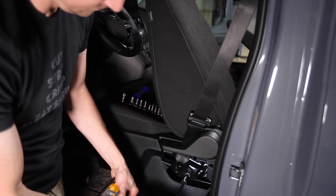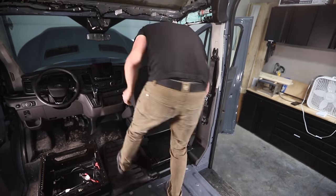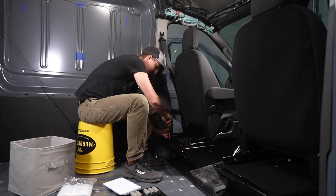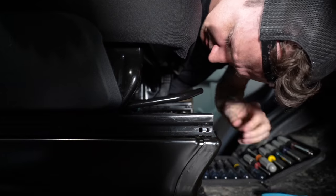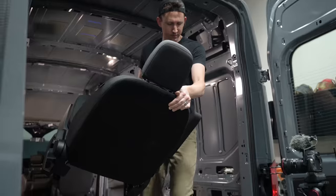The first step in this process is honestly just a ton of prep work. We needed to access the metal under the floor liner and seat pedestals, so we started removing the seats. We slid the seat forward, removed the rear battery tie-down screws, the battery cables, the seat-to-seat base bolts, the wiring harness under the seat, the seat belt restraining cover, the seat belt bolt, and pulled out the seat.